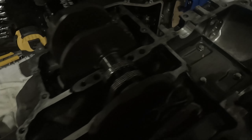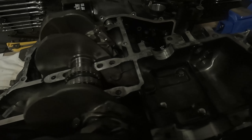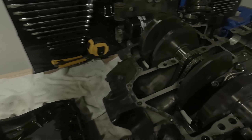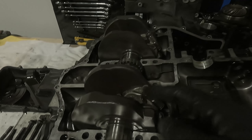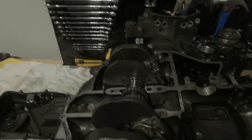The gears are all out. Naive me thought I could just pull this out, but obviously the pistons are not designed to come out from the bottom side. I actually need to disconnect the connecting rods from the crankshaft, and then I should be able to remove the crankshaft and pull the pistons with the connecting rods upwards. So let's take off these bolts at the bottom, take off the little retainer, and pull things apart.